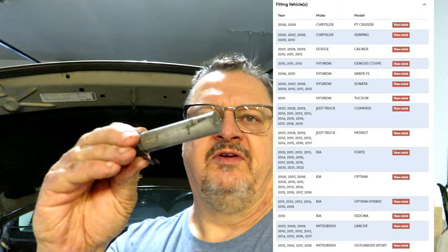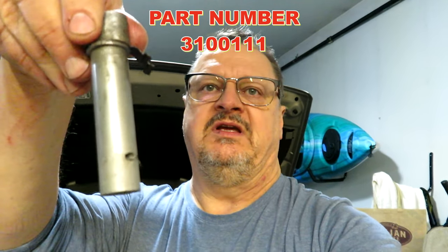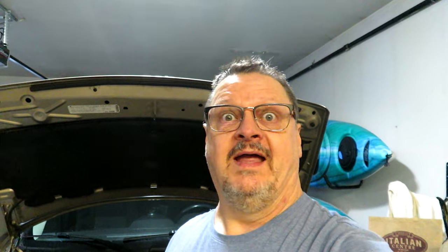That's it for this edition of Mundane Man, where we changed out a faulty block heater on the Jeep Patriot. This block heater can be used in many different applications — there's more than one vehicle using these cartridge-style heaters. The one I purchased was a lot longer than the original, so the cord is kind of up against the lower rad hose at the thermostat housing, but I think I'm comfortable with how it's sitting. These are supposed to be simple — just pull the old one out and push the new one in — however, with that radiator hose in the way, I had to pull that out and work around it. I did skin up my knuckles, which means I must have done it right.